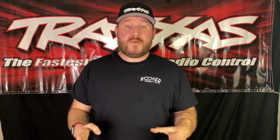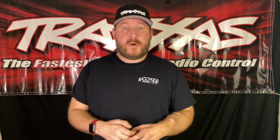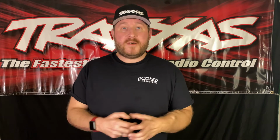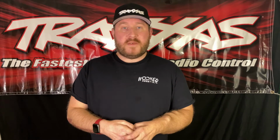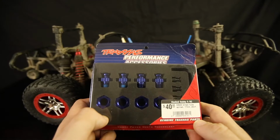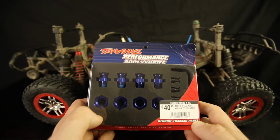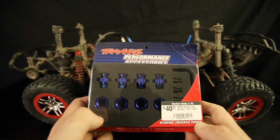Today I'm going to be showing you how to install the 17mm hexes on the Traxxas 4x4 so that you can upgrade your tires to bigger tires that are suited for 17mm hexes. So let's get to it. Traxxas part number 6856X. These are the wheel hubs, and they're splined, and they're for 17mm. So we're going to put these on today. So let's get to the video.